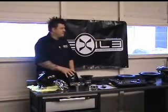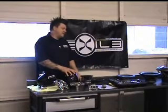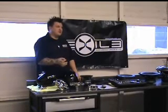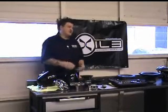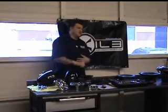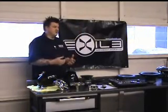How about deck power versus amplifier power? Deck power works well, but not for marine application in my opinion, because you're not going to get loud enough. What happens is you turn it up so far that you're distorting the signal and you're just not getting full performance out of it. Any speaker out there will sound better with an amp — you get more headroom and more transparency between the music.